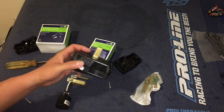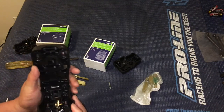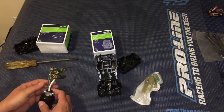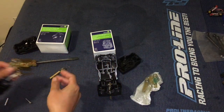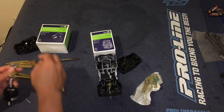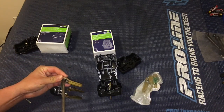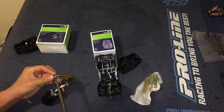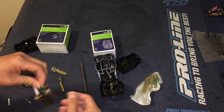That's where these newer 14-50 plugs come into play, because they have both a neutral and a ground, which is great, and the plugs are actually interchangeable. You can see how I've got this set up — I'm going to swap out the L-shaped plug here for the appropriate plug on the 14-50, just unscrewing this and switching over to our normal setup. It's quite handy to have both options available when you're on the road.